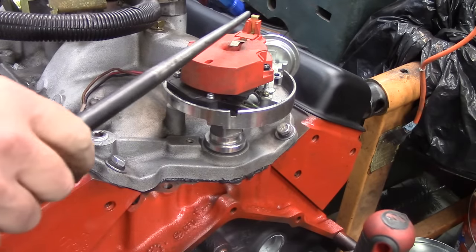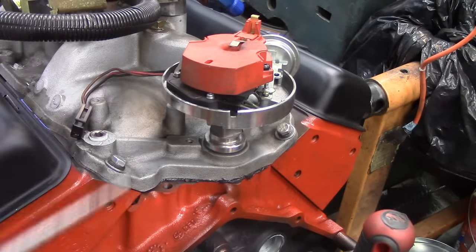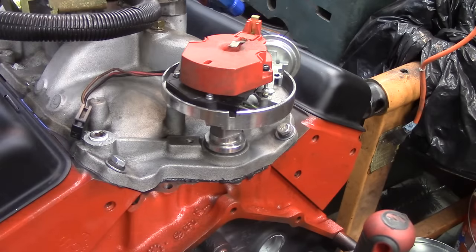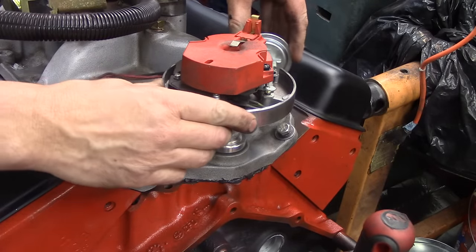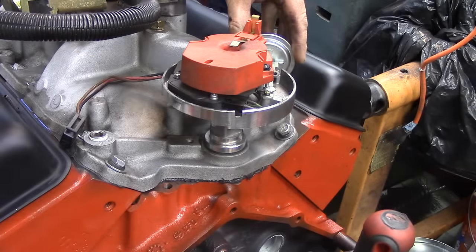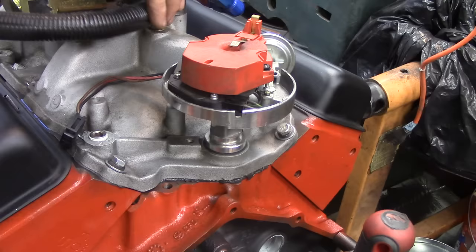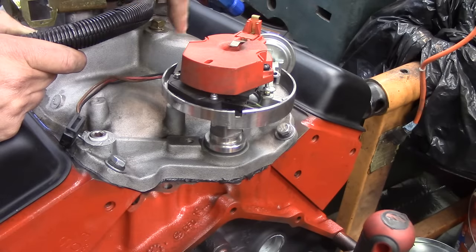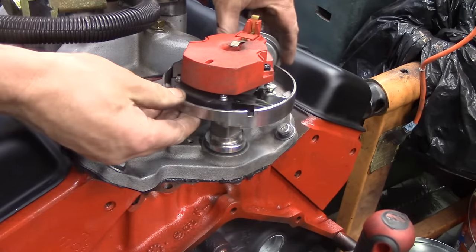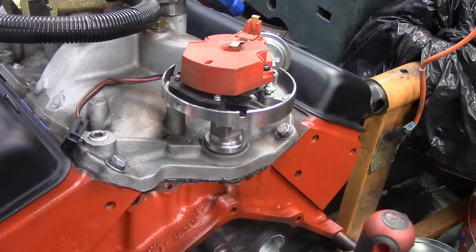I'm still timed because my rotor moved with my engine. If I go back to number one now, my rotor is going to be over here where it needs to be — and that's all there is to it. That'll get you close. You have timing adjustment right here and you can adjust that timing according to whatever it needs to be once the engine is running. The distributor is now in, and it's close enough that if I put my wires on, start here with my cap and go through my firing order — 1-8-4-3-6-5-7-2 — when I go to fire the engine up, this thing should light right up. It should fire up immediately. This is something that gets overcomplicated a lot, but it really doesn't need to be.